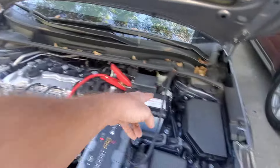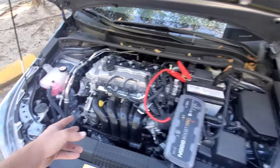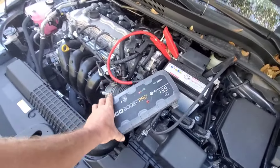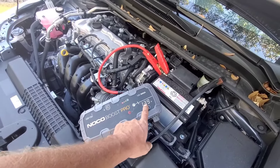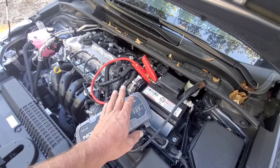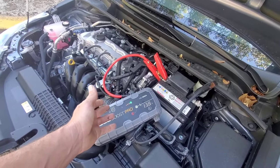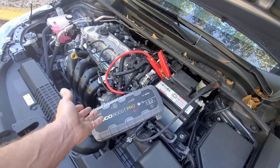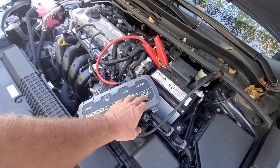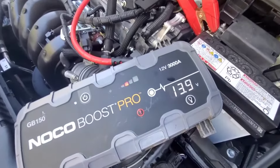The alternator runs off of 14 volts, the battery runs off of 12. Your electrical system in the car is 12 volts, but you need the two extra volts coming from the alternator to charge the battery up properly. If you're not getting that — if you're at 13.7 or lower — then you've got a bad alternator. You need to be 13.7 at the minimum, and ideally 13.8 to 14 volts in order to have a good alternator readout. So that's what we got here.